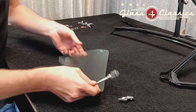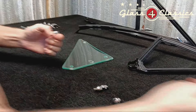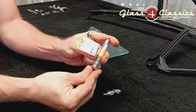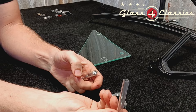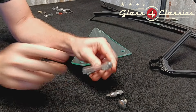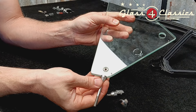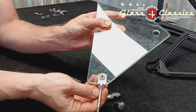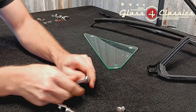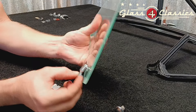When you sit this through the glass, there's quite a bit of free play and you've got the potential for metal on metal. So we go down to Bunnings — these are just irrigation hose, different short lengths that you can get, only a couple of dollars each. 8mm is what we use to slip over the bottom pin, and 6mm to go over the upper pins. Just push that onto there — it's a nice snug fit, won't fall off. Then grab a blade and trim it flush. When we push this through the glass, it's helping centre it but it's also insulating the glass from that metal pin, and it's now only got about a millimetre or two worth of movement, which is ideal. We'll do our top one as well — top and bottom pins, both with the exact same thing. Just carefully trim that back flush, and that's our top pin ready to go.